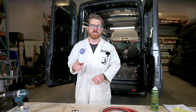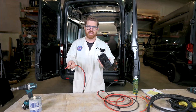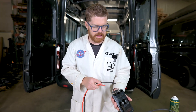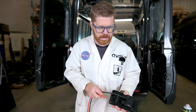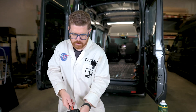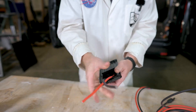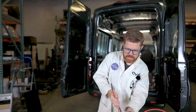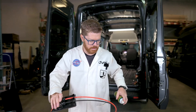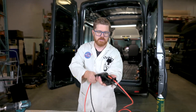All of these products are going to be available in the description below. The first step to getting our setup prepped is to feed our wires into our entry gland. Make sure the nuts are loose so they're not compressing around the housing, then go ahead and feed the wires in. Doesn't matter what color goes on what side right now. If you're having a little bit of trouble, you can use some spray silicone to lube things up and make it easier to pull the wires in.